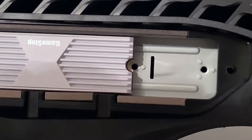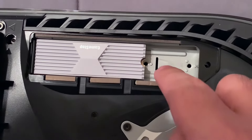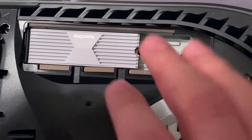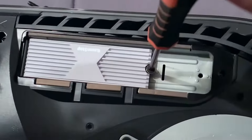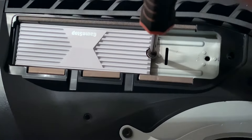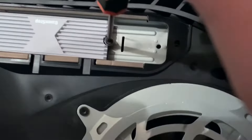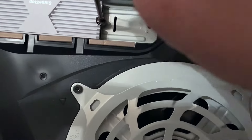Place the washer and screw right there. Depending which SSD you're going to get, it's going to vary in size. Put it there, make sure it's secure, and it should hopefully recognize the drive so you can format it. This was a little bit tricky — you have to have the washer in between there. It's not going to go under entirely, and it's not going to go over. If you have a magnetic screwdriver, connect the screw to the washer so when you screw it in, the washer should be there and keep this secure.